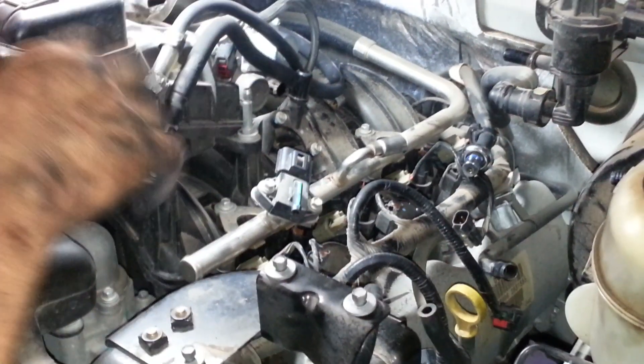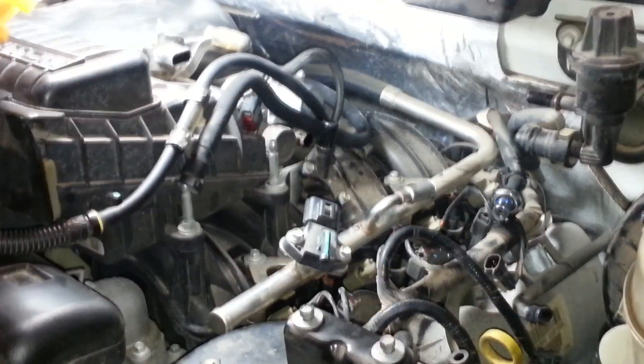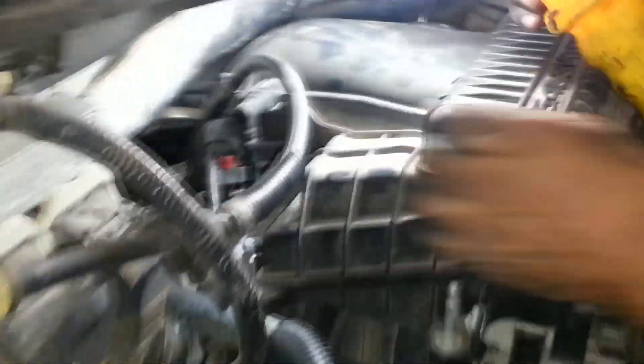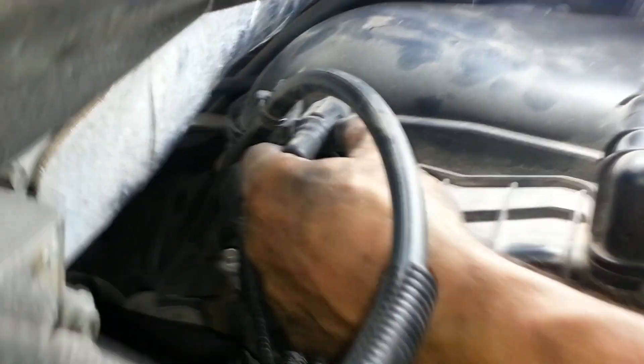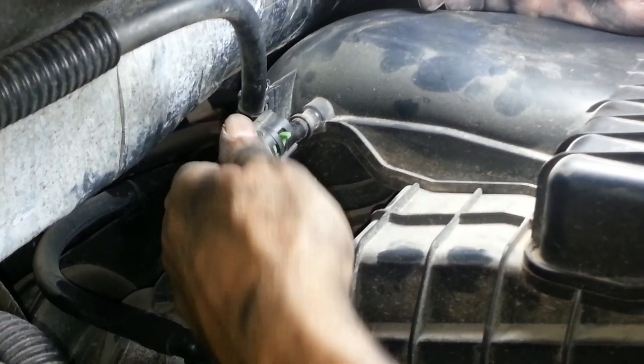As you can see, now we've removed all the lines and we've got all the room. As soon as we remove these screws right here, this rail is going to lift right off and we're going to be able to get to our fuel injectors pretty easy. Now we need to work on the other side to do the same thing. The first thing we're going to have to remove is these lines right here. You remove this line by turning this — see this little green button right here — you just pull it down and pull the hose back and it releases it.